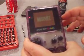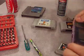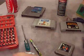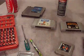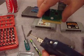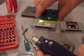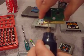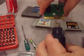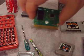Out of all the games I've purchased that don't work, 80% of the time that's all I have to do. Sometimes I've gotten some where the contacts are just so corroded that the eraser won't do it. But if that's the case — and I'm only suggesting this as a last resort — go ahead and get yourself a Dremel with a fine little brush. Don't go high speed; this one is DC powered, not very harmful. Turn it on very, very lightly and go across the terminals. When you're done, just give it an inspection and see that it's all nice and gold and shiny.